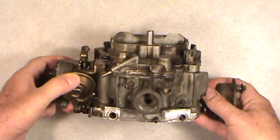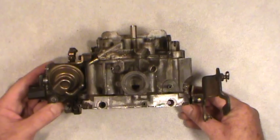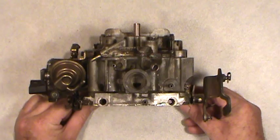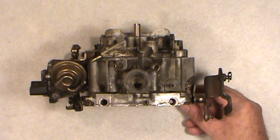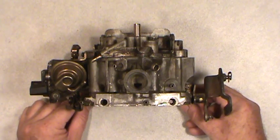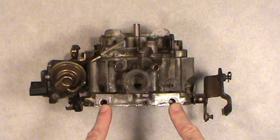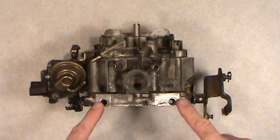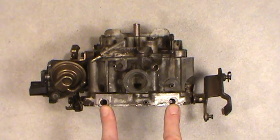Now I'm going to flip it 90 degrees and show you the front end of this thing. For this particular one, like I mentioned, it was a 1980 model, and the same thing would apply for about the same model year for a Quadrajet — meaning a four barrel carburetor with vacuum secondaries. Now normally the two idle mixture screws are sitting right here, depending on the model you have. This particular one had hardened steel plugs over top of these — you'll see holes here right now — and I'll explain how I opened those up.